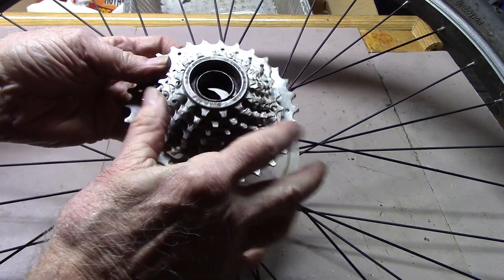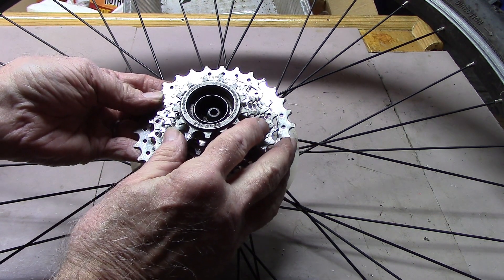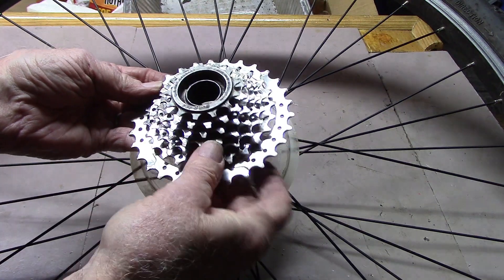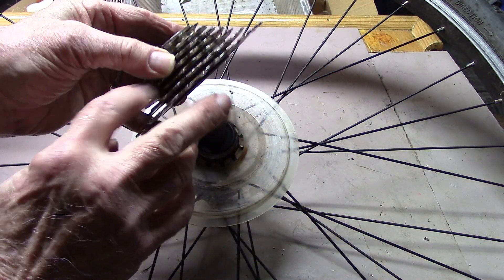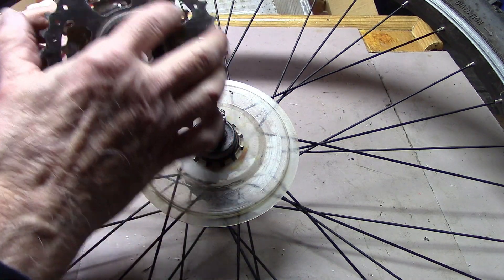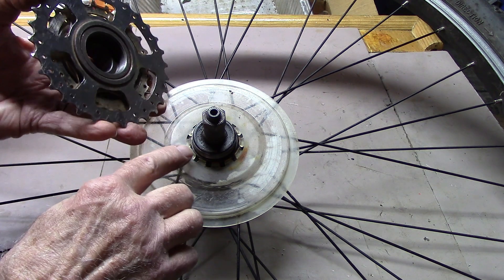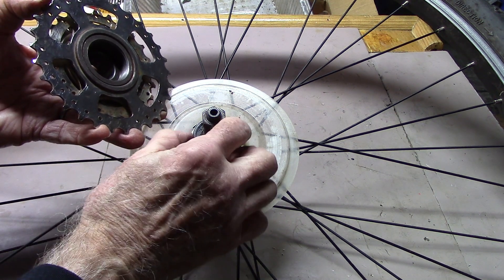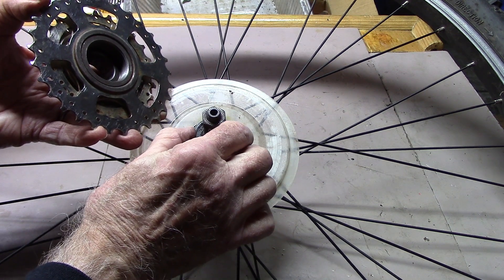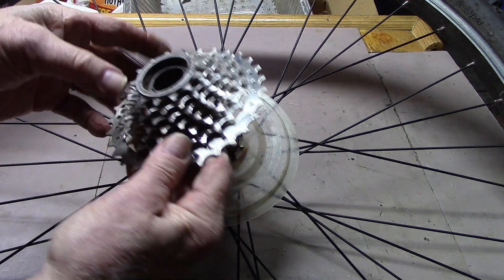If you want more information on removing freewheels, they can be really difficult to remove — we do have a reference in the upper right-hand corner. The freewheel tended to be a lot heavier because it contained the ratchet mechanism within the freewheel itself. One nice thing is that the spindle it attached to was uniform among the hubs, so you can easily exchange one freewheel for another.